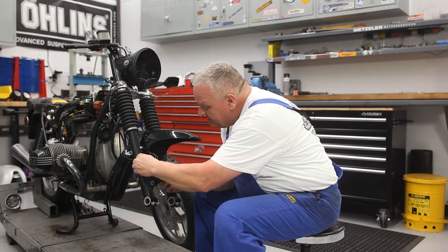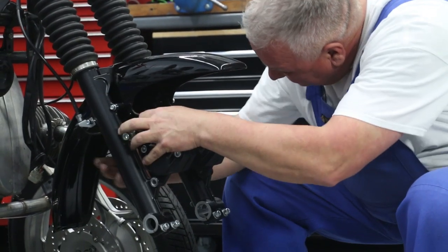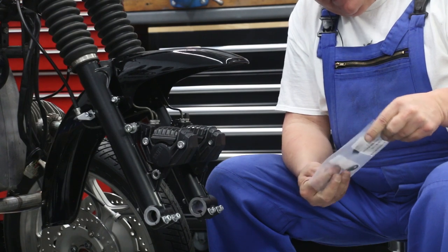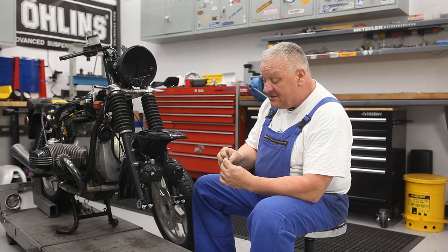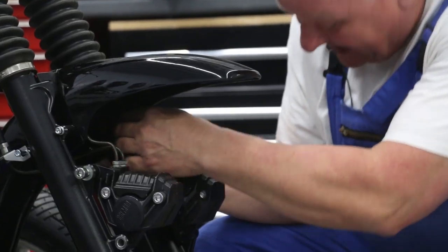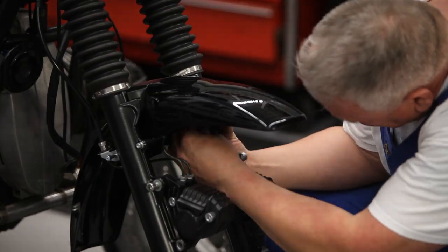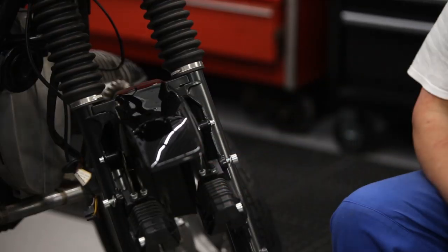I'm just going to put these calipers in with the top bolt just to hold them in place, and then check the alignment. The brake line looks good. These little plastic clips oftentimes get bent and distorted — their job is to hold the cross of a brake line in place, so I'm just going to put new ones in. They basically just go right over the brake line, and then you put a nut and washer on top to hold everything in place — one for the left, one for the right. Fender is on there, it looks awesome.